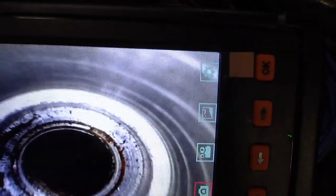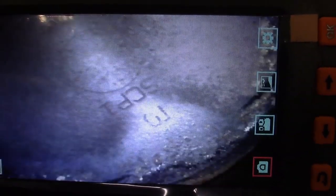There's some oil off on the side there — this thing's definitely worn down, definitely getting coolant in there somehow. That looks really full. Number three was pretty much the same, not as bad, but after sitting for about five minutes it's totally full — this thing might even hydro-lock. So there we are with pressure in the system. The camera is waterproof, so he ain't got to worry about it getting into the coolant. Number four didn't have coolant in there — and cylinder one was dry. So there's what it should look like in these cylinders, guys. We're going to have to take that coolant out so this thing will actually run again.